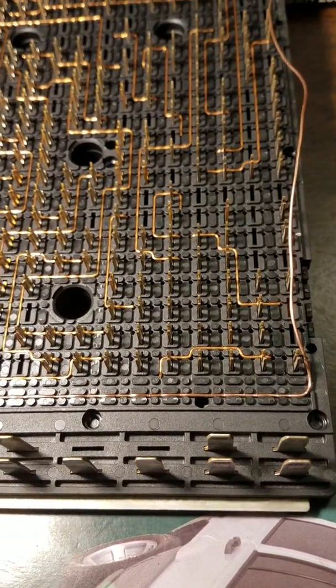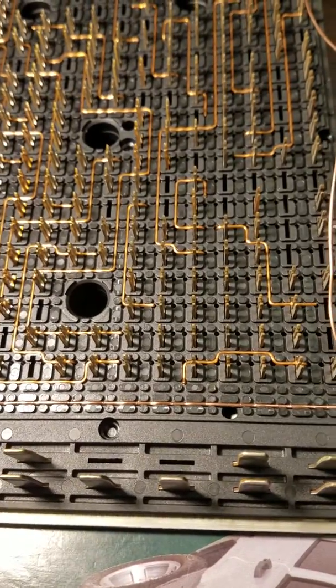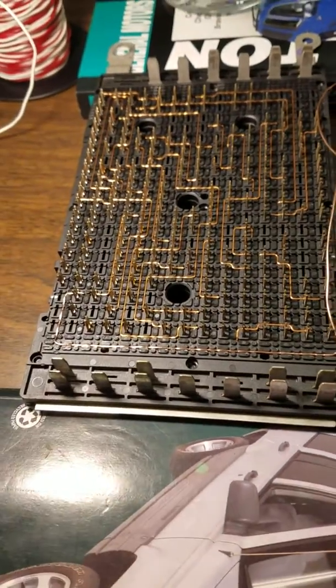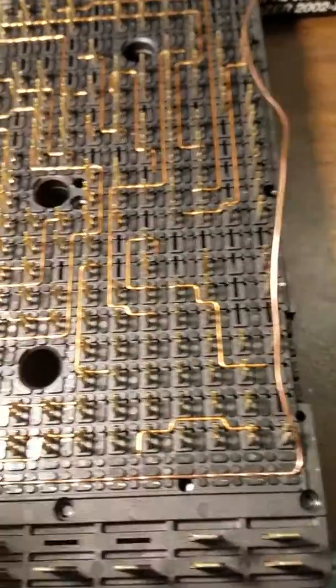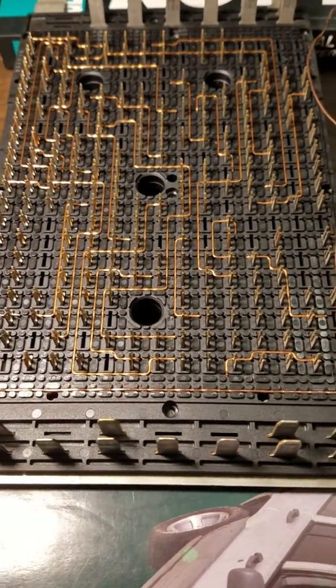I changed the battery because the battery was on the low side, like 12.3 volts — I thought the battery was an issue. Then I checked the relays: a powertrain relay and a starter relay on the fuse box, which is basically just torn apart here. I replaced those, but it didn't help.